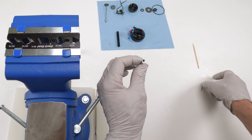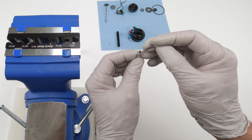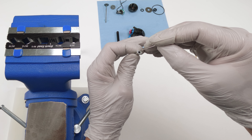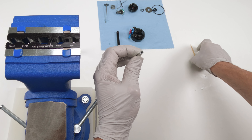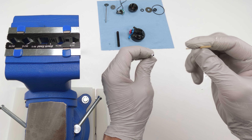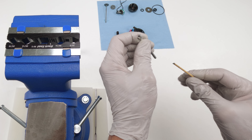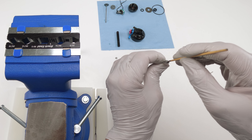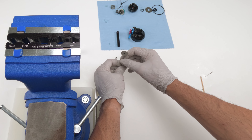To remove the seal from inside the shaft, a needle comes in handy. The seal sits in its seat about there — pierce it on the side to move it out of its seat, then use a skewer to remove it fully. This is where a skewer comes in handy. Then there's a second seal inside the metering rod — use the same technique: force it out of its seat, then push it out with the metering rod if the skewer is too big.